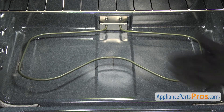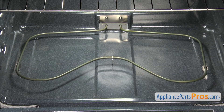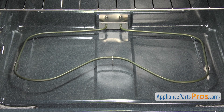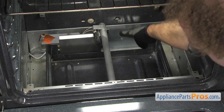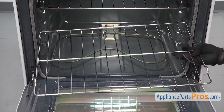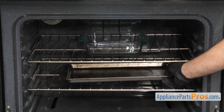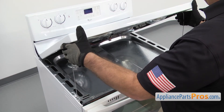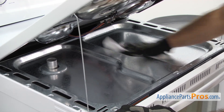With electric ovens, putting foil under the element could cause heat to be reflected back into the oven, overcooking the food and possibly damaging the element. If the foil touches the element, it could become a shock hazard. In gas ovens, blocking air passages could affect the burner operation, causing poor cooking and carbon monoxide poisoning. You also don't want to completely cover an oven rack, as this will disrupt the air flow and cause cooking problems. You should only use a small pan on a rack several inches below the food you're cooking to catch drips. Due to these dangers, you don't want to use aluminum foil to keep the range clean. You should clean the oven and underneath the cooktop regularly to prevent grease buildup.